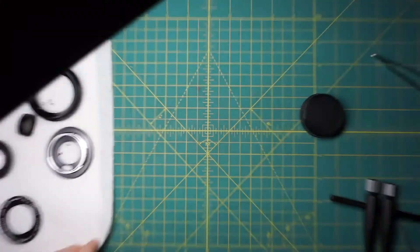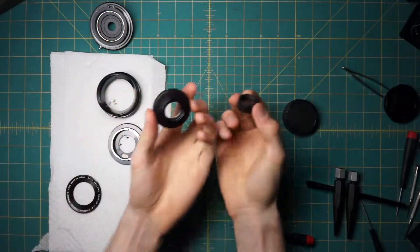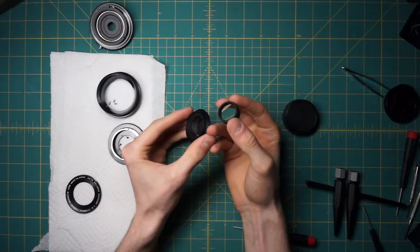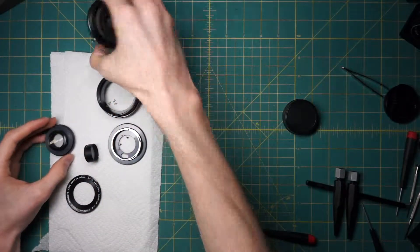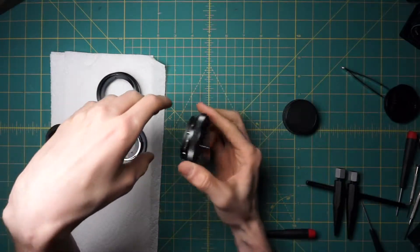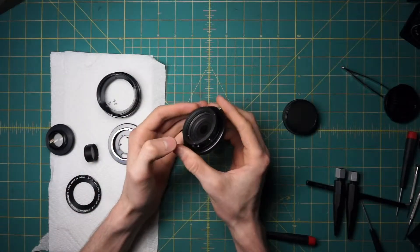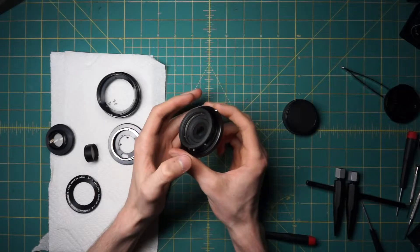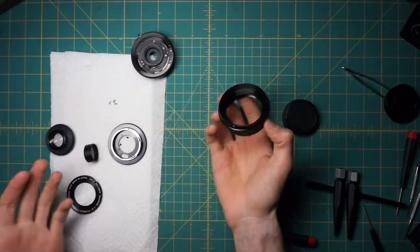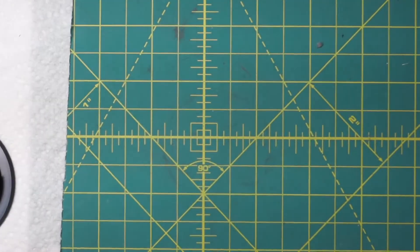So that actually has most of the lens disassembled. We have the optics, which can be further disassembled if there is fungus, dust, or other things inside of them — not just on the exterior surfaces — and that's separate from the mechanical section, which is all really in one piece. Again, you can take apart the diaphragm and get it out of the aperture control ring, but it's a whole lot of work. So unless there's actually a problem, it's a very simple lens when you're taking it apart and not doing extensive disassembly.